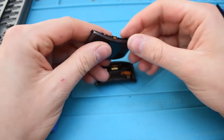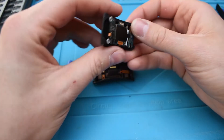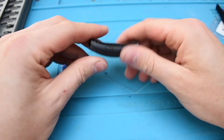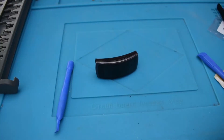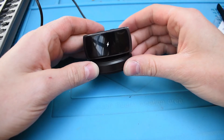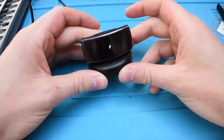This wouldn't even turn on before, so let me put this back together correctly. The contacts here meet up with that, so it goes in this way — very gently put that together, very simple to put back together. Let's get the charging cradle — and it's now charging! Awesome — before there was nothing. So contacts are good, battery is good, and that's back to life.